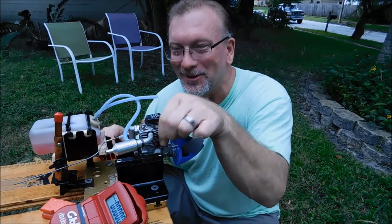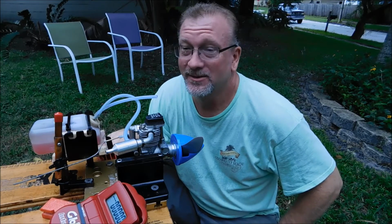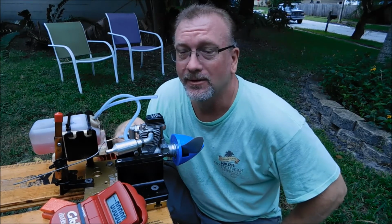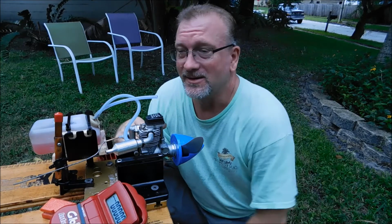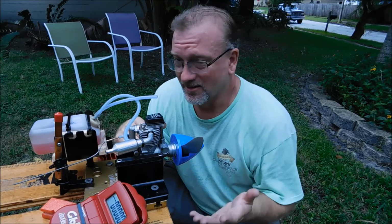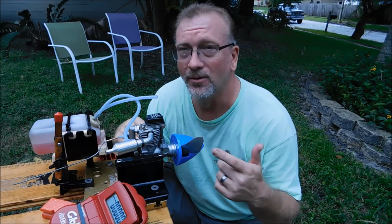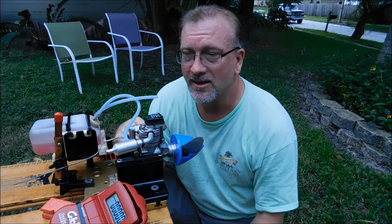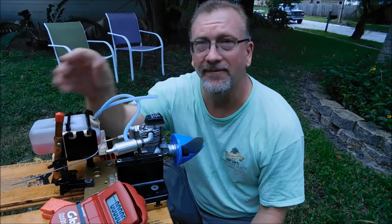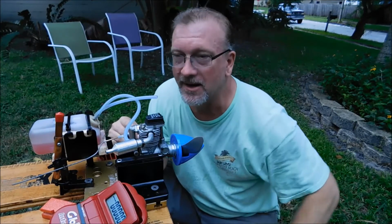Wow, well, I don't know about you, but I found that incredibly interesting. I really had my reservations at first that I was even going to run it. To be honest with you, I have no idea why it took so long to get started. That's probably not going to make the video that I publish, because I don't think it's interesting to see me try and get this thing started with the electric starter. But suffice it to say, I did eventually get it started, though it took a lot. I must have primed it 6 or 7 times, pulled the glow plug out, and shot fuel directly into the chamber. It really didn't fire off until I was sitting at about half throttle. A couple times it fired off, and then I hit the throttle the wrong way and closed it, and it died. And I was like, oh God, am I ever going to get it to go again?